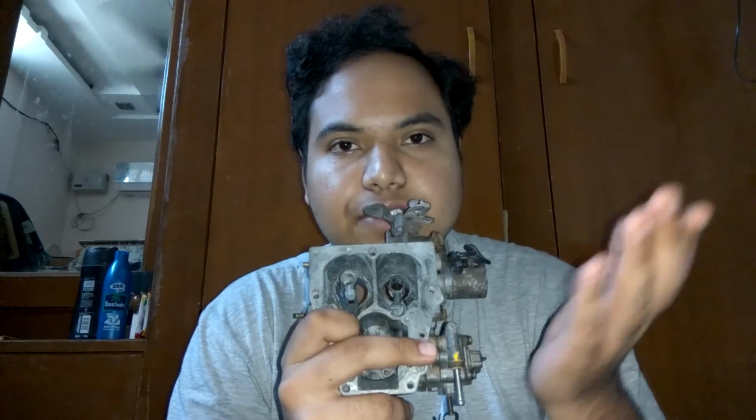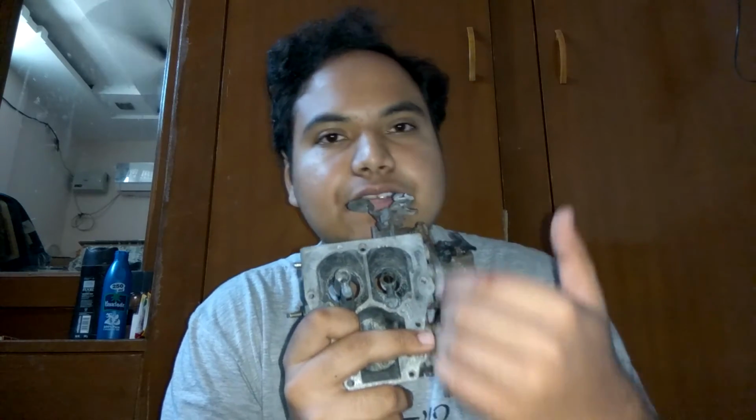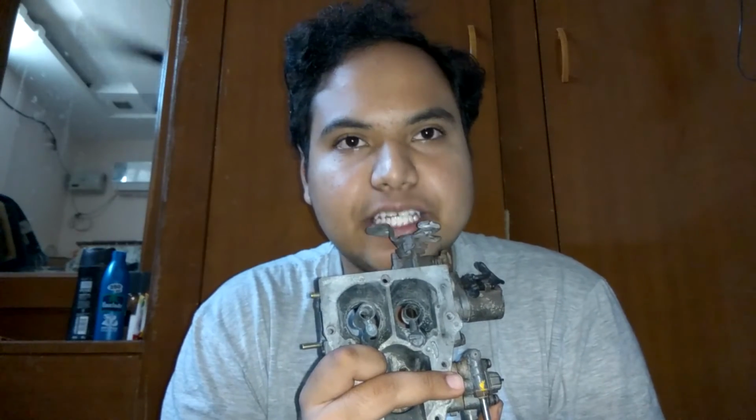And on the other hand, don't go a size too big, because you see your engine has only a capacity of 800cc engine or some other cc. If you are using a Zen, it's 1000cc. If you are using an Esteem, it's 1300cc. And so beyond a certain level, it's useless. Even if you keep on increasing the jet size, there would be no difference that it would make.